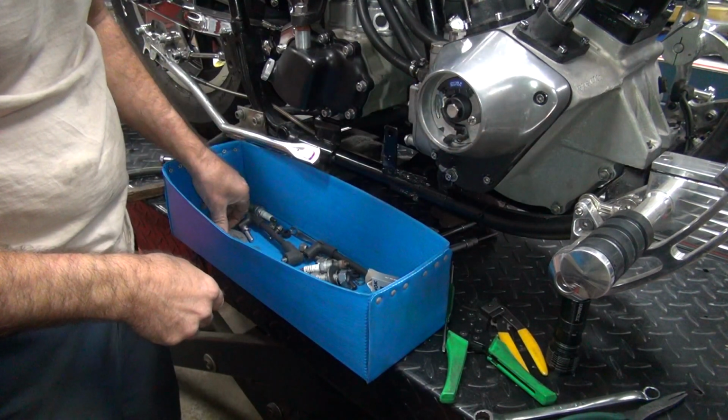So the first one's a crimp. The second one is a strain relief. It makes the wire bend back here in the plastic instead of right where you crimped it. See how it bends more solid. When you solder, it makes it very brittle through here, very rigid. It bends right there and it wants to break right where you solder it. It also weakens the wire from the heat. That's why soldering is not the best. Everybody says it is. It isn't.